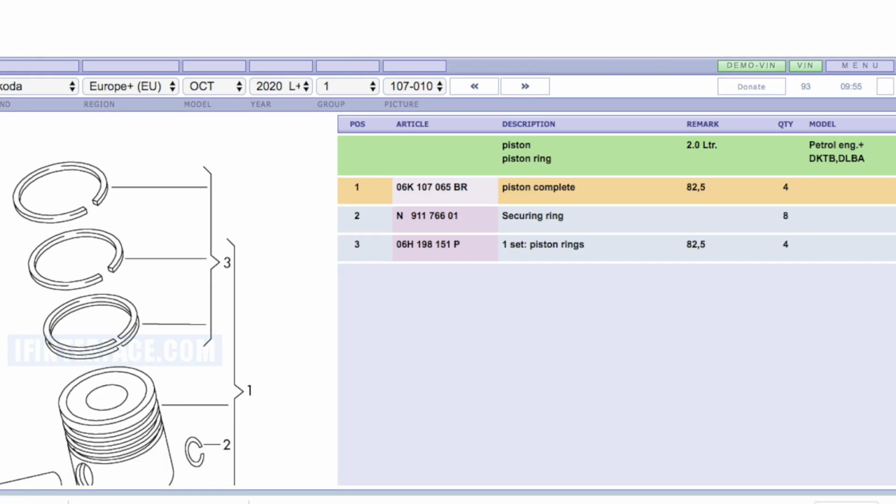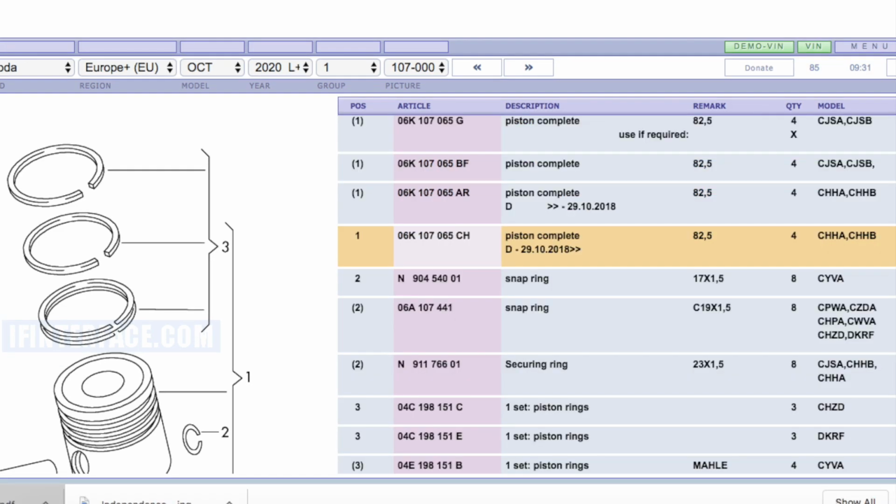The pistons on this car are also very different from the 230. It's a completely different part number and the piston rings are also different. The part number is unique to this car and is not even shared with the Golf R. I'm not assuming that these are forged pistons, but they are slightly stronger cast pistons. The closest match to the part number I could get for these pistons is on the Audi RS5 V6 engine.